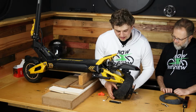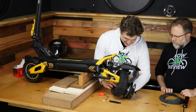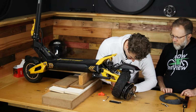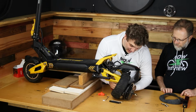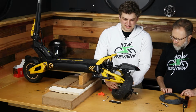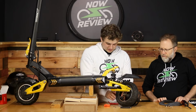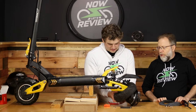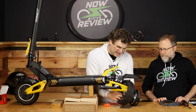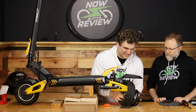We're gonna pull it out, and you can see how this tire was never gonna come out of a rim. No. It's so big and rigid. So that's why they have the clamp. And I really appreciate that, because otherwise, there's no replacing this. I almost feel like these shouldn't be pneumatic. I almost feel like they shouldn't be inner tube. That's what I mean. They should be more like a car tire, since they're dealing with car tire forces. Yeah, that's true. Or just not air at all. That way there's nothing to pop. Yeah, because we've had this happen to a bunch of our big scooters. Yes. It's almost always the rear wheel. Right. And with a bike, you have a little bit more play because it's just bigger. The tire has more space.